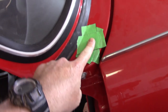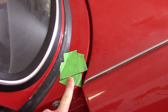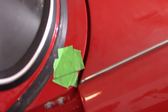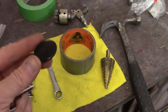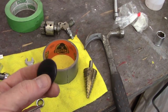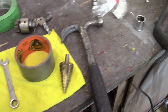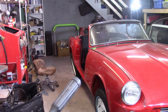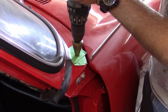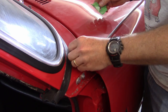Now what I'm going to try to do — and I'm scared to do it — is the antenna hole in this car. I believe they are from the factory about an inch wide, and somebody drilled a hole in here that wasn't very circular. So I've got my step drill and I'm going to try to drill it out about an inch. I've got this plug that is designed for that, just a little bit less than an inch. I'll have to go to 7/8ths and see if the 7/8ths works for me. Hopefully I don't destroy the paint in that area — that's why I've got like three or four layers of tape there to try to keep the paint together.